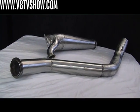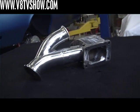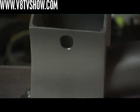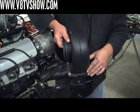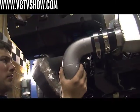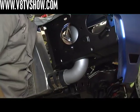After we had all of our parts made, we cleaned up all the metal and sent everything to Extreme Powder Coating in Minnesota, where they applied a 2,200 degree black ceramic coating to all of the hot parts — the exhaust manifolds, our crossover tube underneath, all of our exhaust components leading up to our stainless Magnaflow exhaust kit, and the turbo housing itself. The cool side — the tubing on the intake side — received a coat of Eastwood high temp engine paint, their new nano ceramic stuff.